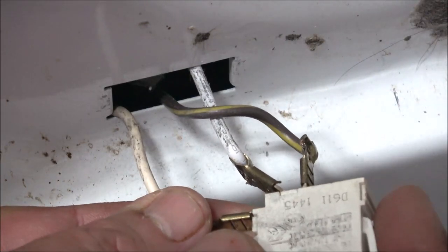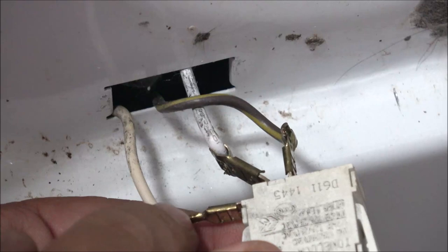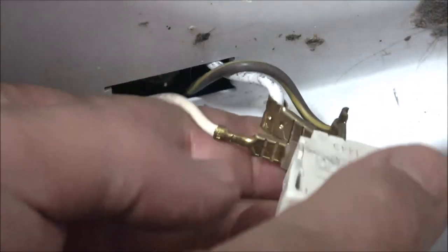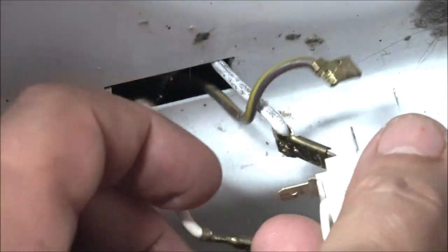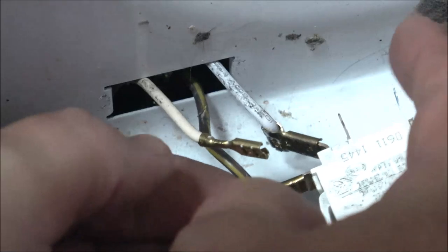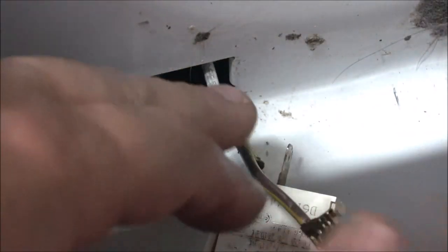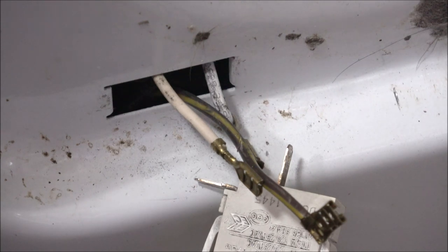Now if you want to check it: this connector is for the light, and this one — the brown one — is what operates the dryer to turn it on and off, including the heater element. If you want, you can just switch these two around — put the brown one where the white one was and the white one where the brown was. Your light should not come on but your dryer should work. You can run it that way until you get your part in, but I'm not sure about the longevity — it's a switch and I don't know if it's rated for more power on one side. I do know it'll work because I tested it that way.